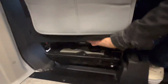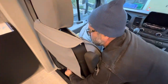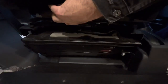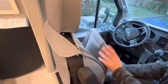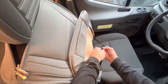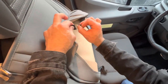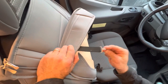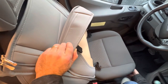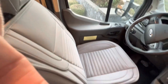I'm going through the back of the seat, the lower portion where the factory flap is. There are obviously two of these. I'm going to take the second one, doing exactly the same thing — lifting up and reaching for that chuck tab. Now I've got the front seat cushion area. You'll notice we have what I'm going to call the underside seat belt strap and also the little clips. It's really important to pay attention to where you're going to hook them into the seat — there's a metal band.